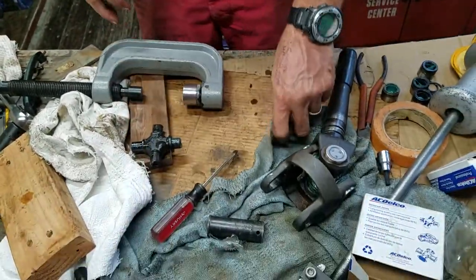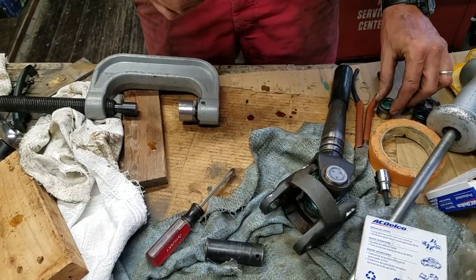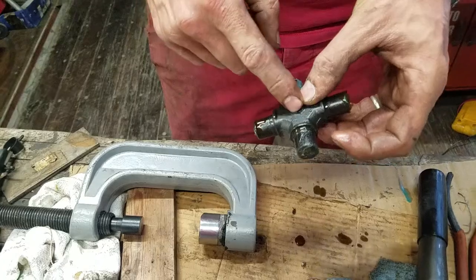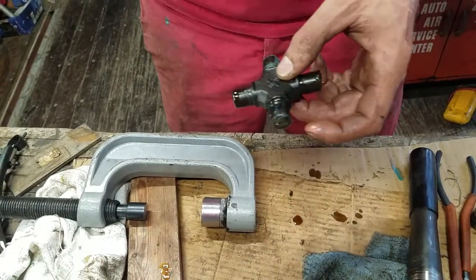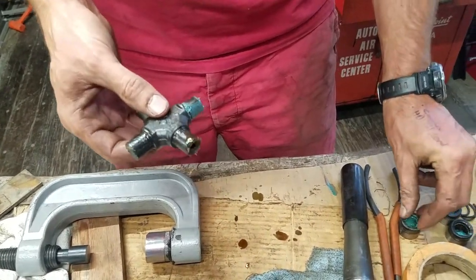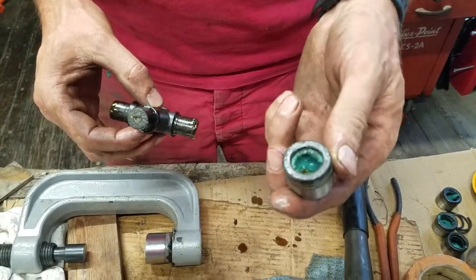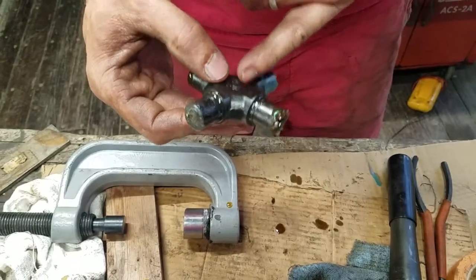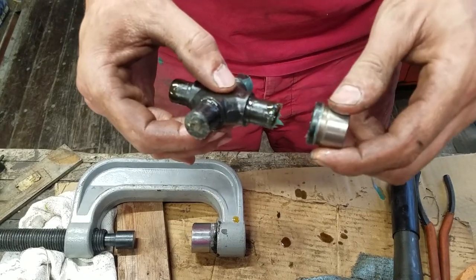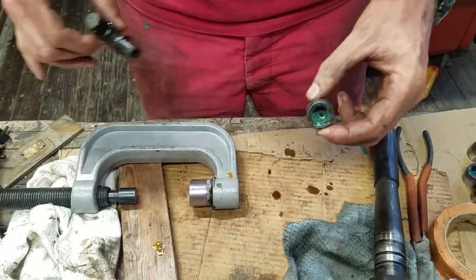Taking out isn't such a big deal — it's putting in that causes a lot of problems. These are non-greasable, so they have no Zerk fittings, though some have one. With all of them you definitely want to pre-grease them. If they don't have Zerk fittings, just pump some grease into the housing like so. If they do have grease fittings, don't pre-grease because it pushes the caps out — you'll do that at the end once it's installed. For these, just grease it up with some EP grease, which is extreme pressure.